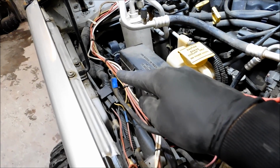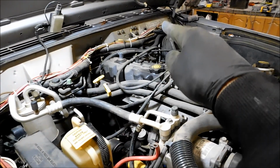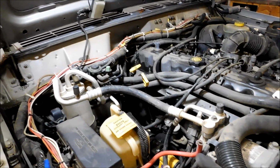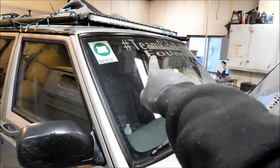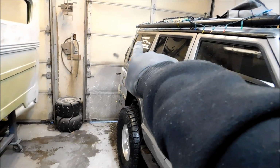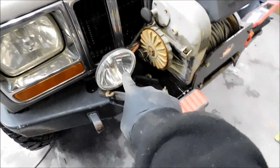and then my makeshift harness runs along my factory harness and goes into the cabin with the fuse box. Then I have several switches inside that run my lights. I have flashers here, I have a flat light bar there, side light bars, a rear light bar, a rear flasher, rock lights on the chassis, and fog lights on the front.